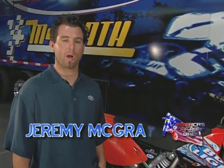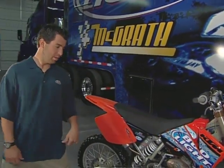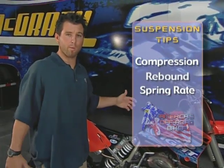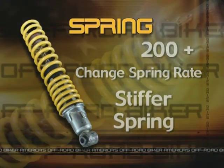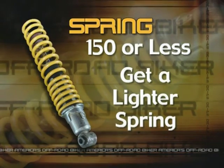Guys, today we're at McGrath Racing and I'm going to see if I can give you a few helpful tips on your suspension. There's three basic things you need to think about: your compression, your rebound, and your spring rate. Depending on what weight rider you are, 200 plus, I'd say you need to change your spring rate, make a little bit stiffer spring. If you're 150 or less, you need to get a little bit lighter spring.